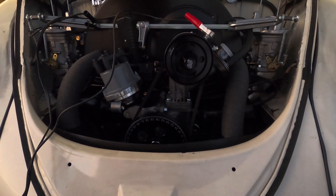At about 3100 RPM, whenever it stops moving and dancing is where you'll know it's set. If you set this gun at 30, you want it flashing on top dead center — that's when you know it's good to go. If you have any questions, please comment and ask. Like the video and subscribe, thanks.